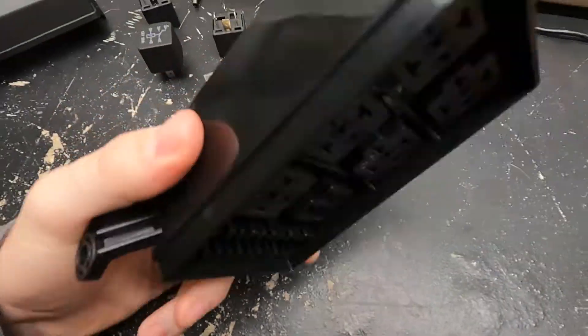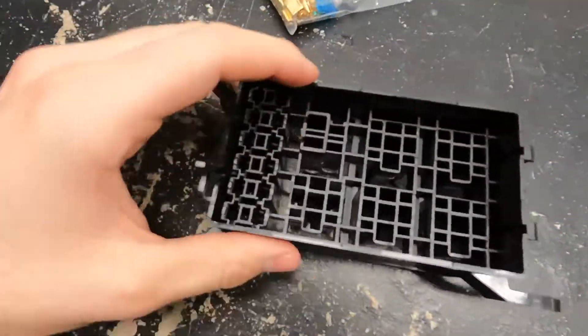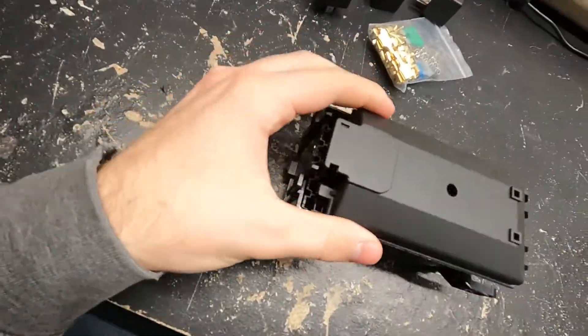Let me show you the bottom. So this is what the bottom looks like — there's the top and the bottom. You can put all those terminals in here and do all your wire routing underneath, and then all your wires will collect and come out this hole. I think I'm going to mount this right underneath where my intake is in the wheel well on that frame. I'll probably either find a hole or tap in some riv nuts so I can mount this box in there. Then I can route the wires down the outside of the frame rail through the wheel well and into a little grommet towards the back of the wheel well that goes inside the car.